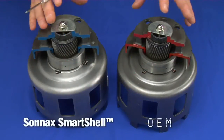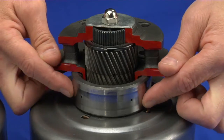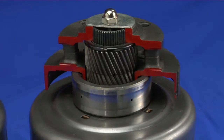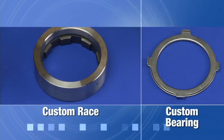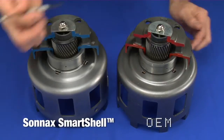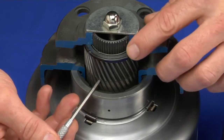As a comparison, we have two shells with the planet cut open to reveal planetary interiors. With the OEM, the roller clutch race has its own independent end play, so it's allowed to float against the black plastic thrust washer. As the parts are compressed together, this loads the captured bearing in the rear planet. With the custom race and bearing included with the Smart Shell, we took up all the clearance between the roller clutch race and the shell, and by eliminating the chamfer on the rear of the sun gear shell, we are able to introduce a small amount of end play into the sun gear itself.